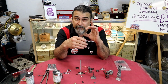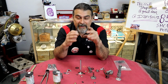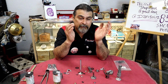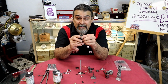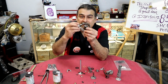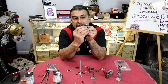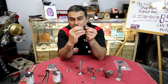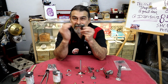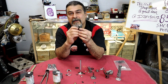And the ports are pretty good sized ports. Well, when they ported these ports, this is the way that we got it. We touched them up and equalized them all, but they were previously ported. It was an older race motor. And now that the port is bigger, the guide actually sits in the hole, and it sits up higher. It's not sitting any higher, but the port's bigger. So as the airflow is coming in, it's going to be hitting, hear that? That's what the air's going to be doing, trying to go around that valve guide.